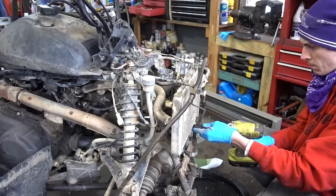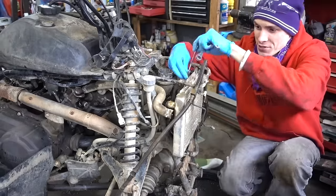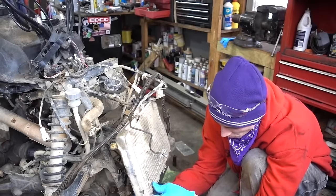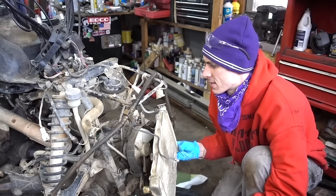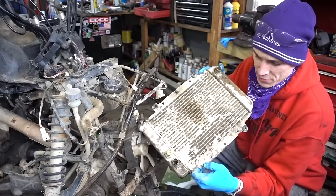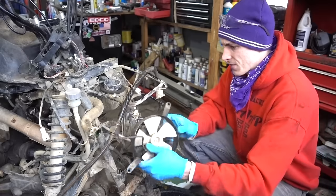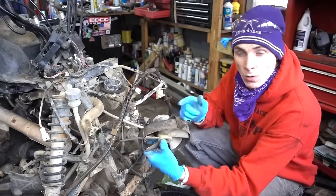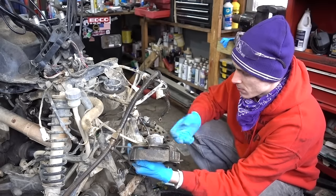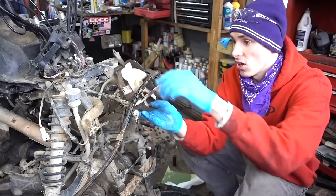We're on a mission from God. Thank you Fat Lee for the ratcheting wrenches — they're coming in handy. As you guys can see, this radiator isn't that clean. If I show you the back side, I'll show you why it's not cooling down properly. Maintenance is key, especially if you want stuff to work right. This radiator is pretty clogged, so I'm definitely gonna wash this before I reinstall it. Also, this fan is hardwired to always run — some makeshift electrical tape here — and it runs right to the back. That's no good; it's supposed to run off the thermostat. Now that I've got some room, I can finally install the new brake lines.